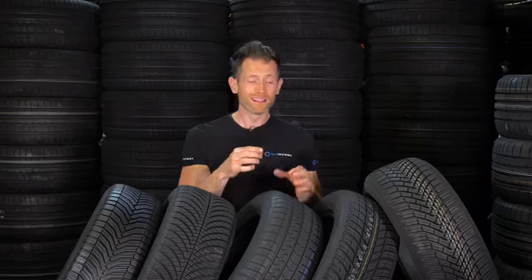So there you are — that's my top six all-season tires and one special all-season tire. The keen of you will have noticed there are no budget recommendations, and that's for a very good reason. All-season tires are the most difficult tire type to get right, and like budget winter tires — which can be really good in snow and ice — they're terrifying in the warmer, wetter conditions which we do get over winter. So don't think a budget all-season tire is a good choice. It's not — it's going to be compromising your safety, especially in the warmer, wetter conditions we so often get in the UK.